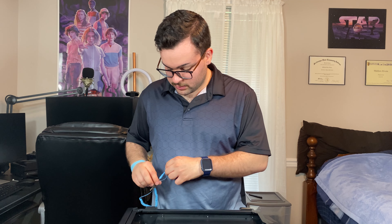By the looks of it, the CPU arrow is going to be facing this way, and the arrow on the socket is this way. We're going to ever so slightly fit this in — hopefully not bend any of these pins, because if we bend any pins, we're screwed. We're going to slowly place this in — and it fits perfectly. Then we're going to do the exact same process of lifting that little post, pushing it down, making sure it's still in. We're good. We move this down and in — and we are good to go. This thing is locked in.